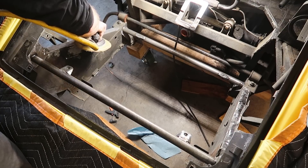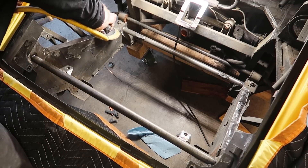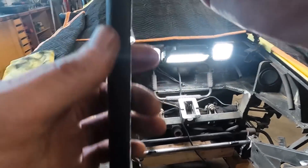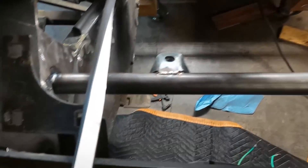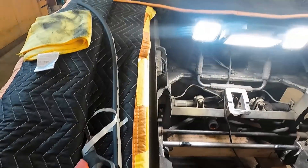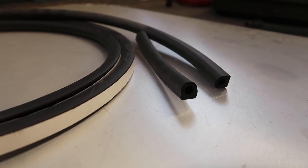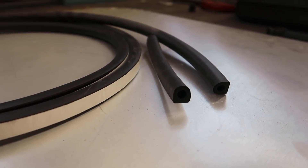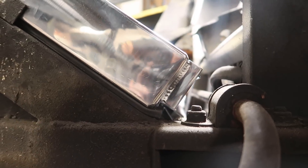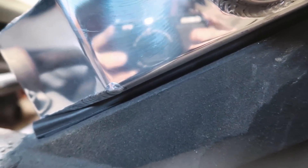There is one final part and step that I want to do. The first part of that is cleaning off the tops of the chassis rails — I want to adhere a seal to them and I'm going to need a good surface to do that with, although I will have to redo these seals later once I actually paint things. What I'm using for a seal is this stick-down bulb seal that I bought from a local hardware store, and it's only a few cents a foot. This stuff has a super strong adhesive on the bottom of it and it is nice and collapsible, so the radiator should seal down on this stuff really well. That's going to help for ducting and it will keep it from being too solid mounted against the chassis.